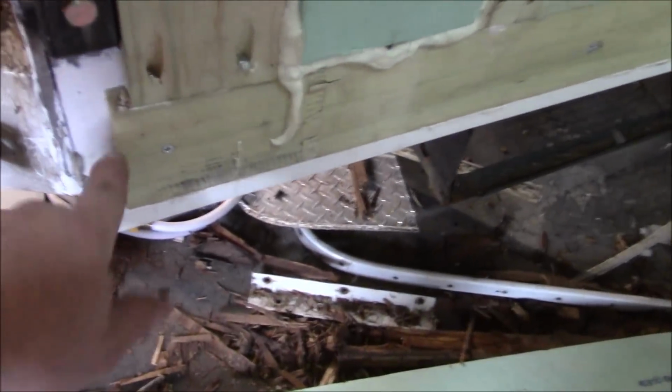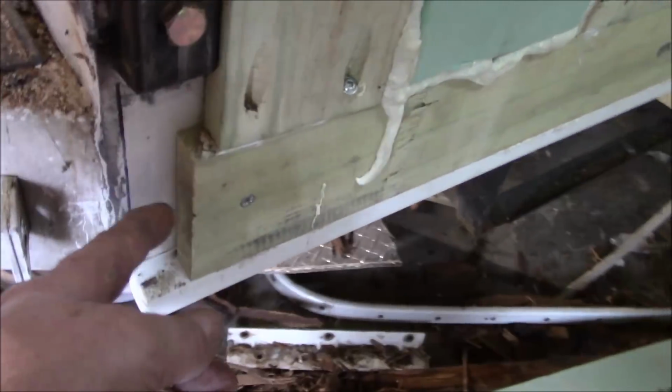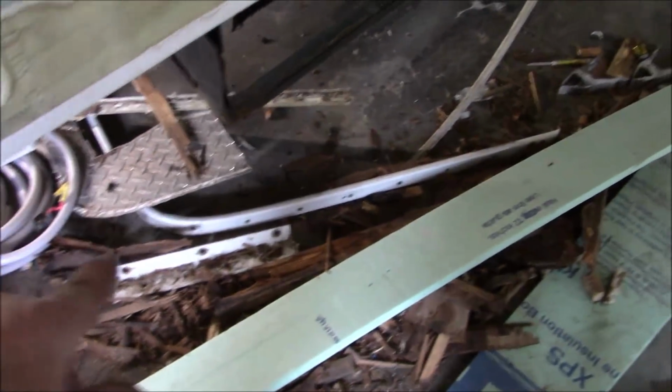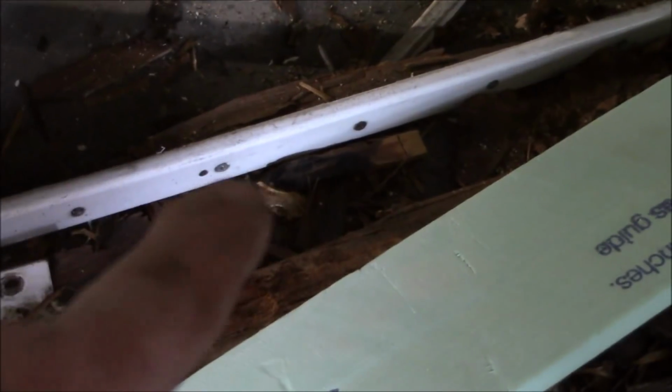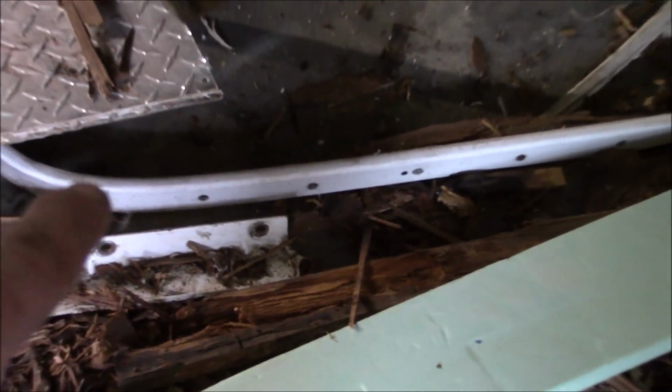And that's a piece of plastic framing. That is in there because that's a thin piece of wood, and it's only a piece of 3/4. That trim mold, which is down here, right there. See all those screw holes in it? Look at all those. If you start flying all those screws right through this piece, you're going to end up splitting it.